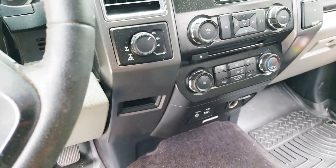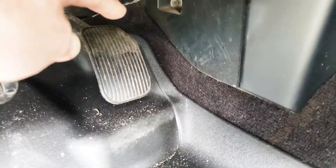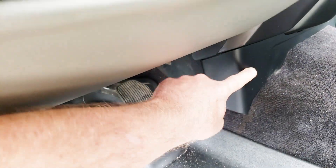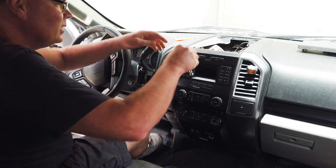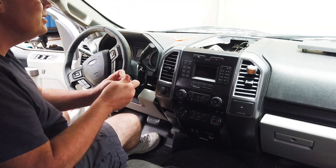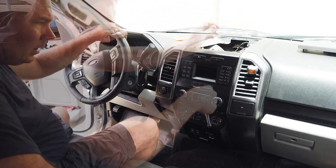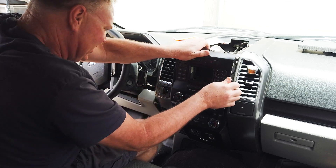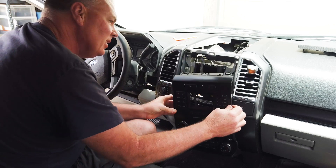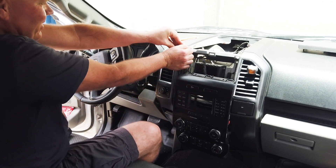To get this area out you've got to start with this piece — I've already got it loose, you can see it pops down. You've got to start with this bolt back there and then this piece will come out right here. There are also these two bolts here — we've got to bring this forward, they are seven millimeter. Then this is going to pop straight out — just got to give it enough of a tug. There we go, that's out and loose.